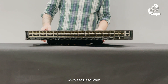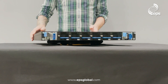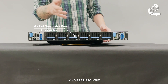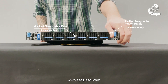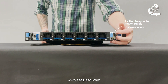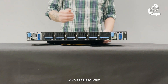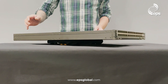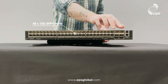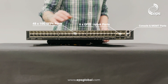The box can also be called the AGR-120 — you'll see both names. On the back side we have six hot swappable fans, one of which is redundant, and two hot swappable power supplies. These are DC power supplies, but the model also comes in AC, with airflow from front to back as well as back to front. On the front side — the business end — we have 48 10-gig SFP+ ports, six 100-gig QSFP uplink ports, and our console and management ports.